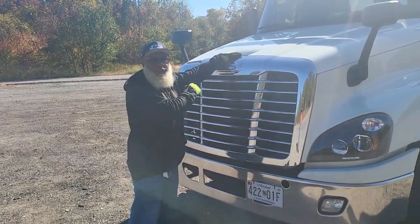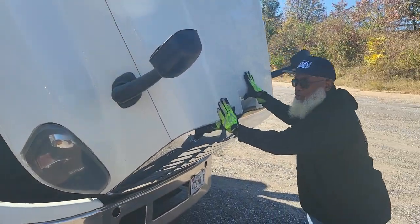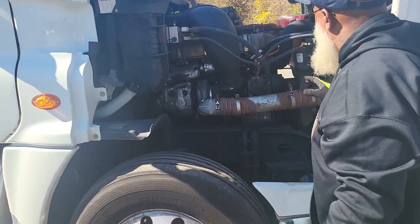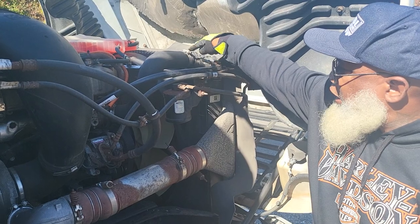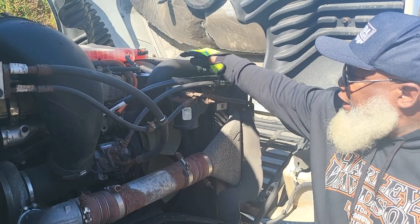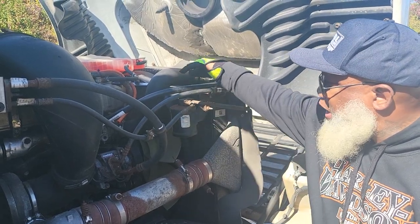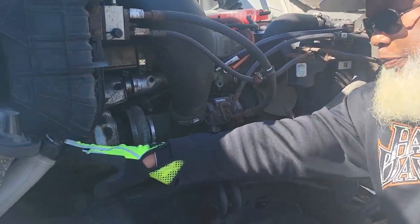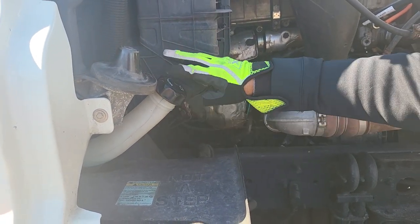Now I'm going to open up the hood and go to the passenger side engine compartment. We have the main radiator hose — it's not cracked, not broken and secure, not dry-rotted or frayed, it's properly clamped and no leaks. I will inspect all remaining hoses the same way. The windshield washer fluid reservoir has no leaks and the cap is hand tight.